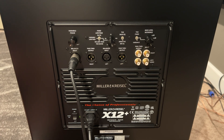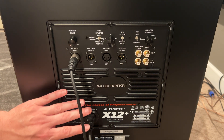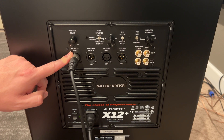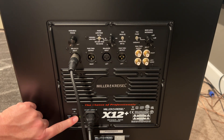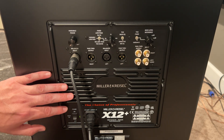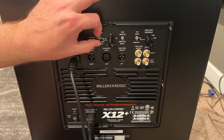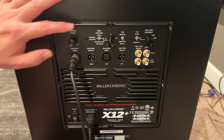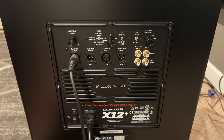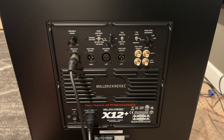To kick things off, let's talk through the setup of this subwoofer so you can understand how we're gonna measure it and how we're gonna listen to it. Remember, as I measure it, it'll be in the standard spot in the Home Theater Fanatics basement theater, but the settings for every sub are a little different because everyone has some different features. From a connectivity point of view, I'm using a balanced input coming off my Acurus Act 4. There are three different power settings and I'm just going to leave it powered on all the time during testing. I'm going to set my phase to zero — I'm not trying to do any time alignment, I'm just measuring the sub.